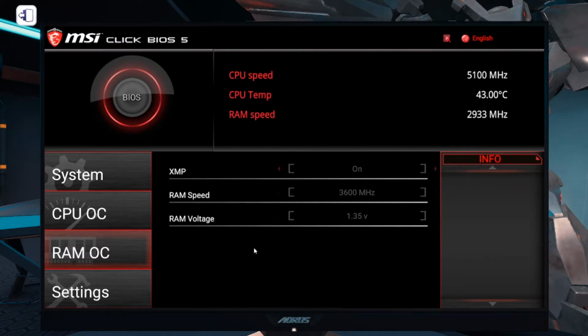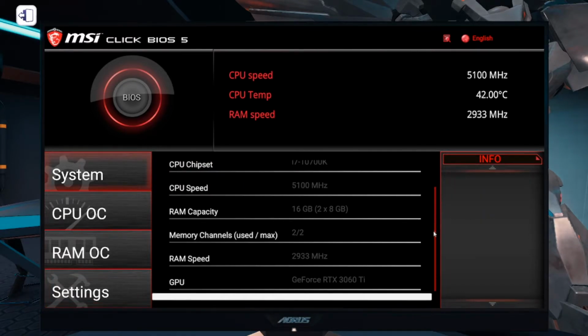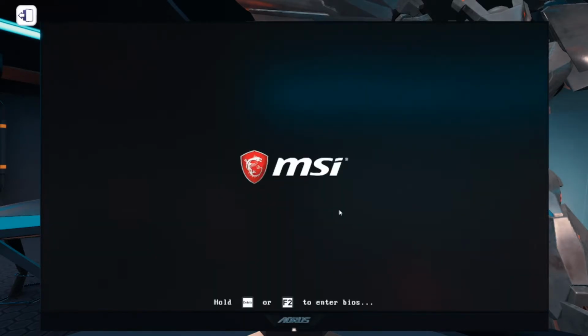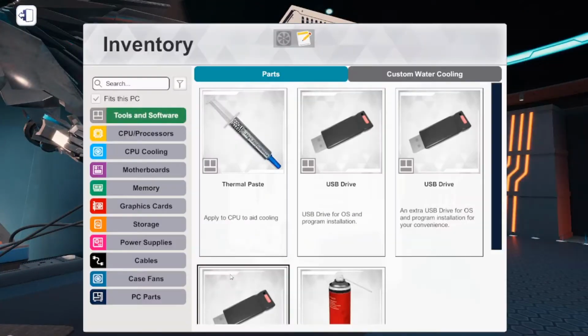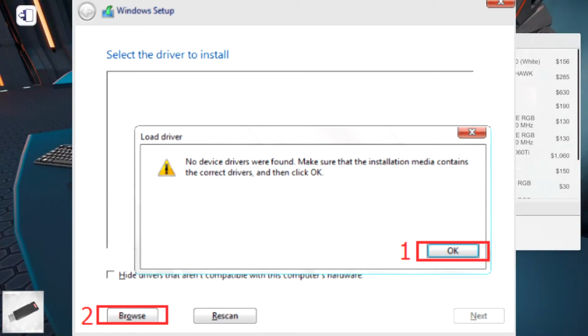However, it wasn't job well done just yet because the PC hadn't actually fully booted, simply because we hadn't tried to load Windows yet. So after we finished configuring our BIOS, we had to plug in the USB stick I prepared with a Windows download on it, and it didn't work. This is where things started to get a little bit tricky and we started to panic, because when you plug in the USB stick into your PC to boot Windows from, you're supposed to go to a screen where you select your languages and then you press begin installation process. Once you do this, it prompts you to enter a product key, but in our case it did not do that. Instead it said we were missing certain files or driver files, and we were very confused as to why this was the case.